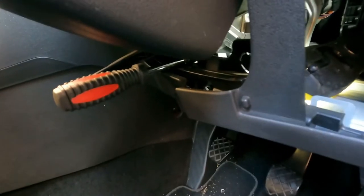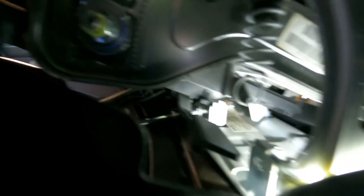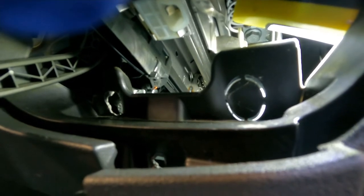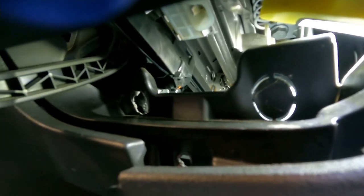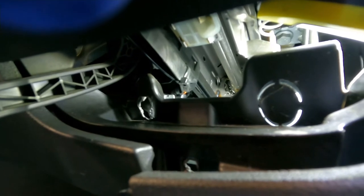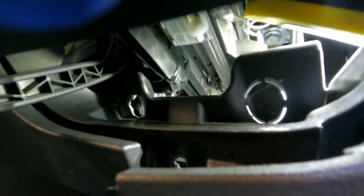After lots of messing around I've finally figured out the airbag. The driver's side airbag will release to come out. I've just got a socket on — there are three 10mm bolts: one there, two at the front. They have plastic inserts, but to actually gain access to them you just punch them out — that's why they're serrated like that. After about an hour of messing around trying to get trim off, once you punch those plastic bits out on the left-hand side you get access to the 10mm heads to enable you to undo the airbag.